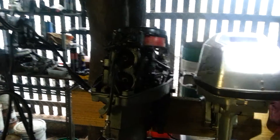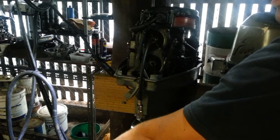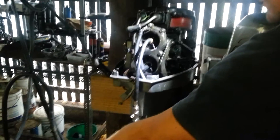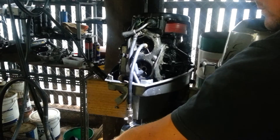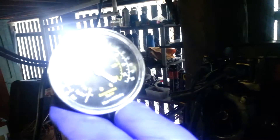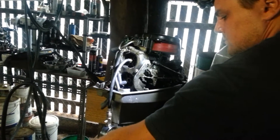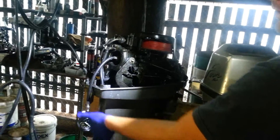Okay, here we go. The battery terminal isn't connected properly, but it should be good though. So that's just over 120 PSI — 122, 123 PSI. I'll do it again. Just over 120 PSI on the top cylinder.